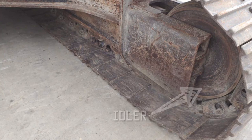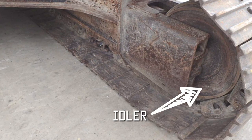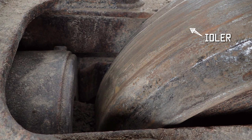This wheel is the front idler — it basically carries the front of the chain and does not provide drive. To the left of the idler you can see the tensioner, which is like a pressurised large hydraulic ram. It makes sure that as the chain and undercarriage wear and get a bit slack, you can pressurise it up with hydraulic fluid and it'll keep the tracks tight.